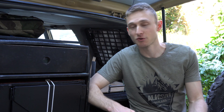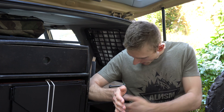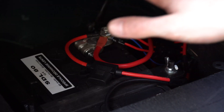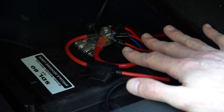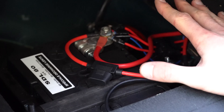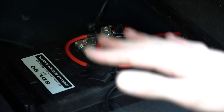I'm not a professional electrician, but when I did research on the internet about making this dual battery system, I heard a lot that the capacity of your aux battery shouldn't be bigger or smaller than your main battery. From what I read, my 80Ah aux battery is actually a bit too big compared to my 63Ah main battery, but so far I haven't had any problems. There are a lot of things directly wired to the battery, and I think I should really consider installing a fuse box for a cleaner and safer install — but I have all my fuses organized so I know which one is which.